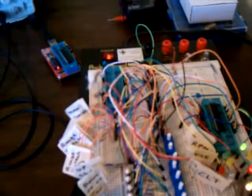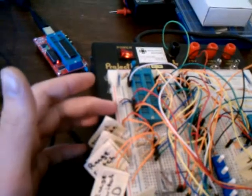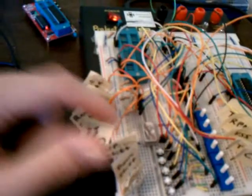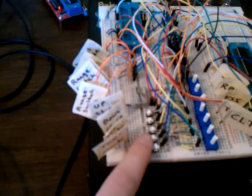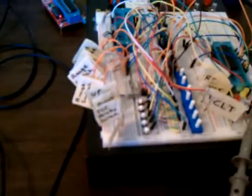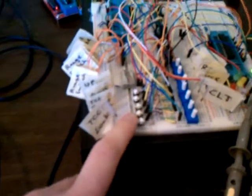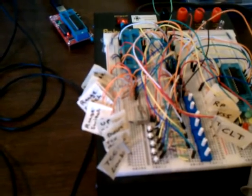On the board, over here we have the manual switch. I'm using wires right now with pull-down resistors to provide switching methods. I don't have any dip switches right now. We've got the manual override here. These 4 orange wires correspond to the range switch. Top momentary push button here is the manual upshift. Second one is the manual downshift. Third one is the torque converter clutch brake switch, which releases the torque converter clutch when you apply the brake. Fourth one is the torque converter clutch lock — it'll actually just be a normal switch.